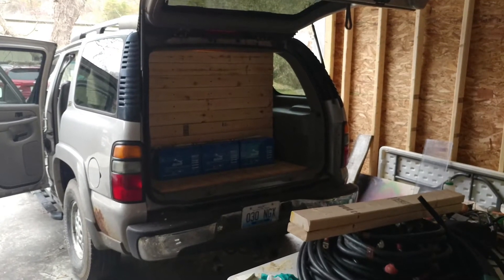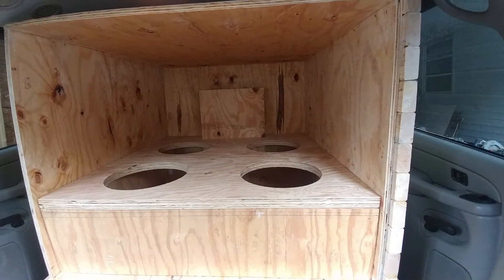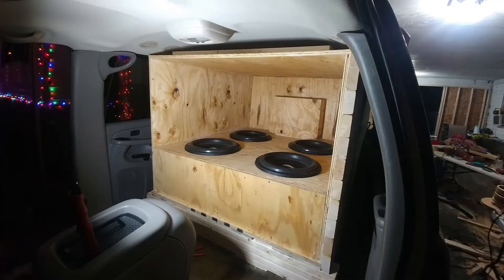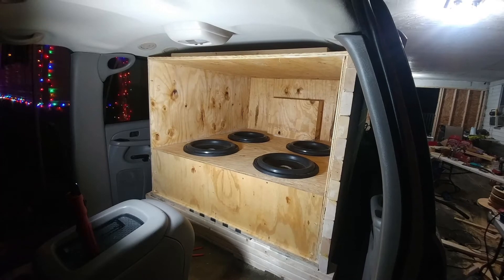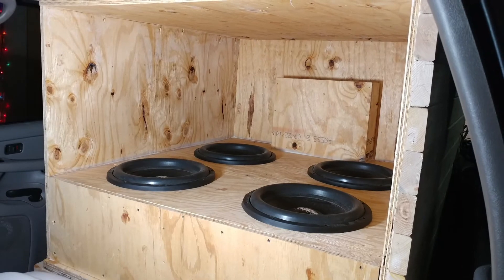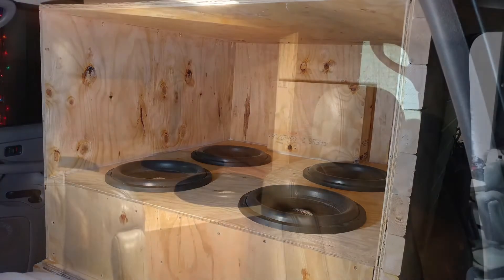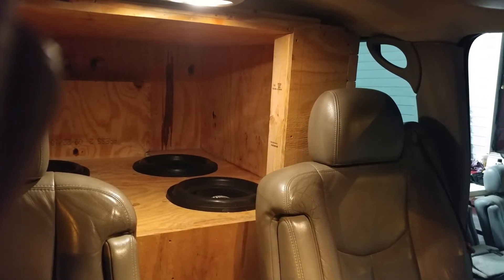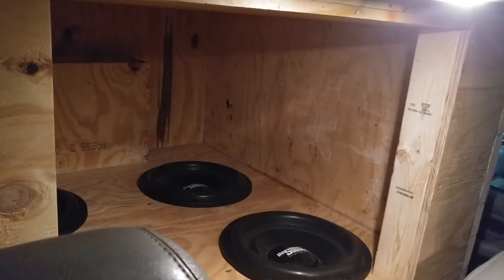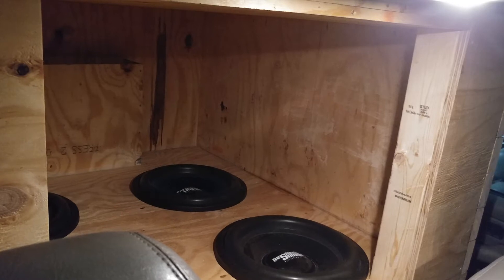The batteries ended up being mounted on the backside of the box. You can see the rear chamber and the port in the back. I think this was a two-to-one ratio box. The rear chamber was tuned to 20 or 25 Hertz — I can't remember that for sure. I don't remember what the front chamber is tuned to; it seems like it was around 50 Hertz. It's been a little while since that box was built.